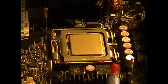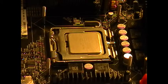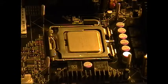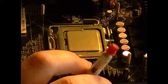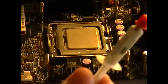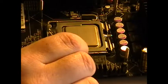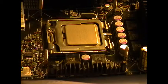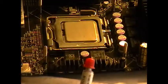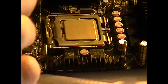So here is the heatsink compound. It's got metals in it that allow for good heat transfer. You'll see a lot of different ways of doing it online, and the amounts they put on are sometimes really excessive. This stuff will get all over your fingers - don't use a towel because you might produce some static electricity on top of the CPU. Just use your finger. This is called thermal compound, and the best stuff I've found is Arctic Silver - I would get the Arctic Silver, the heat transfer is really good on it.